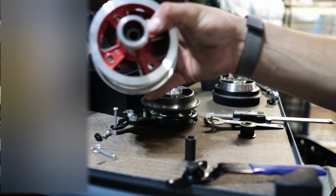Next, you're going to have to cut down the spacer that comes with your hub to approximately 40 millimeters. And you could print this little guide here to keep it centered if you want. After you do that, you're going to have to do a couple different spacers as well. If you buy a used E200, it'll come with big spacers you can cut down, or you can just buy these, of course, from Ace or Amazon, whatever you want.